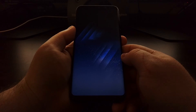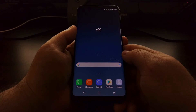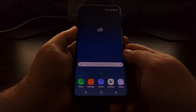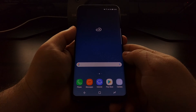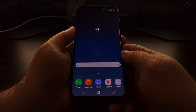That will bring you right back into the Android operating system. The 'do not turn off' warning is only for when you're flashing something and installing something from the PC with Odin or any other piece of software — you do not want to restart while flashing firmware. But as long as you haven't initiated anything like that, you can reboot out of download mode and back into Android. That is how to boot the Galaxy S8 and Galaxy S8 Plus into download mode.